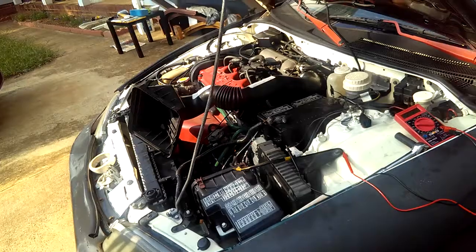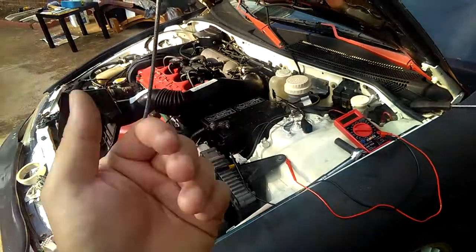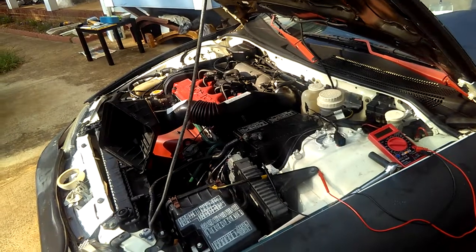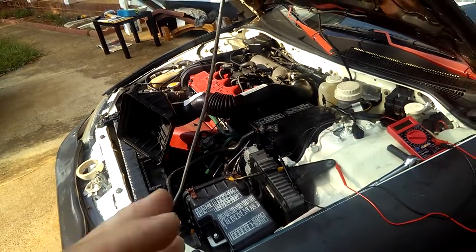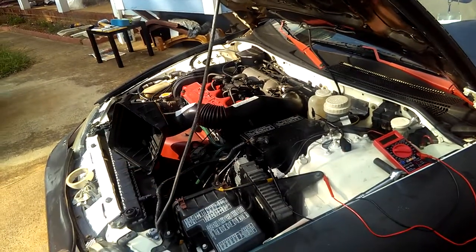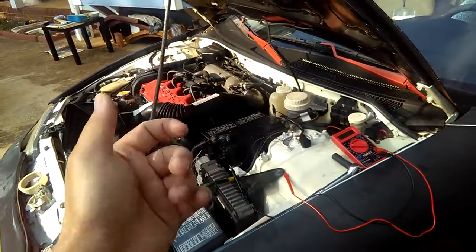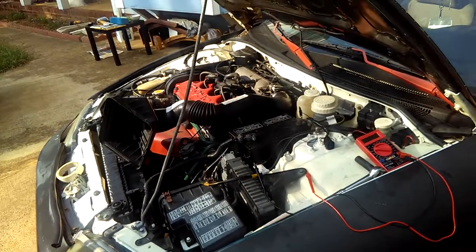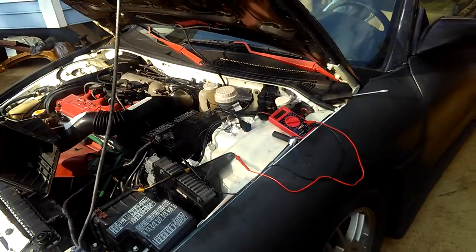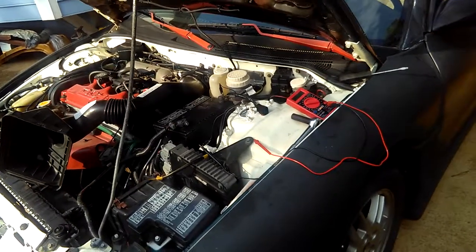The very next thing I should do is take out my battery, get down to the speed sensor, loosen it off, take it off, and check it. There should be oil around the speed sensor too when I take it off. I should be really careful doing that. Don't let it drop the gear or anything, because there's a gear attached below that. I'm going to upload this video, and I'm going to make a next video showing you guys when I'm there, okay? Taking out the battery and the speed sensor, and showing you guys when I go online what speed sensor to order and all that too, and then continuing on from there. All right, guys.